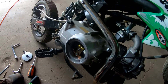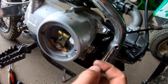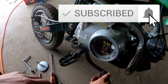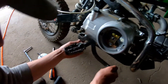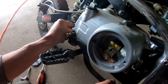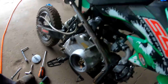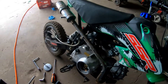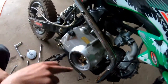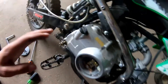We're going to attempt to take this cover off. Basically you ought to unhook your clutch cable — we'll do the final unhooking when we get this back. Dipstick can stay in. Kickstarter has to come off and I believe we can clear. We might have to just take this brake lever off just to be safe. Pull the spring to get it out of our way, and then the cover is going to have to come straight out. We're going to hope and pray that we don't ruin the gasket. I actually do have a gasket though, so always make sure if you're going to do one of these clutch jobs, order the gasket ahead of time just in case you ruin it, which is very likely.